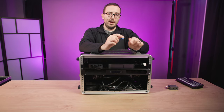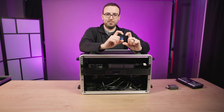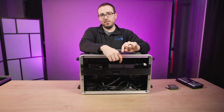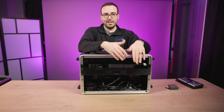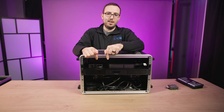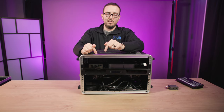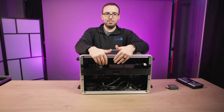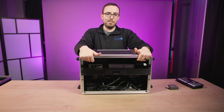I can use that exposed USB to access the computer. The wireless keyboard also uses a small dongle transmitter plugged into the back. We have one HDMI output on the Mac and we're leveraging a USB-C output for a second HDMI output. On the other side is a gigabit Ethernet switch with power over Ethernet — one Ethernet cable gets internet into the Mac mini and the other powers one of the Blackmagic devices, saving us from adding another cord.